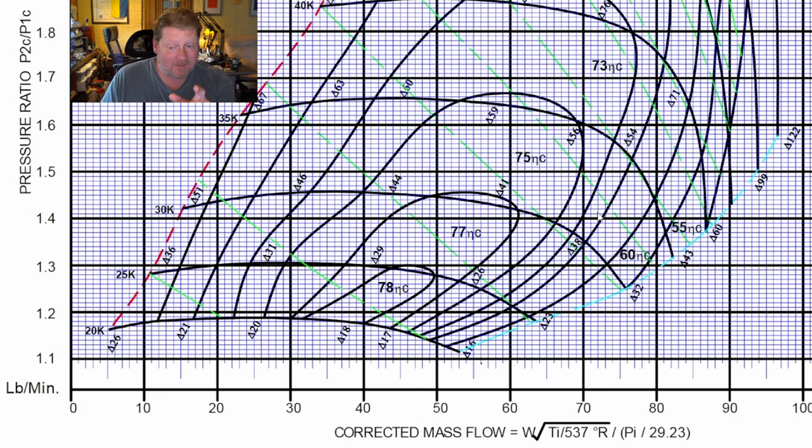It's frightening how accurately it all lines up. I'm getting to the 720 flywheel horsepower number with a brake-specific fuel calculation based on the data log from the EFI in the car, and all these numbers just happen to line up magically. That really translates to roughly 545 to 550 at the wheels if we could take care of the converter slip issue.